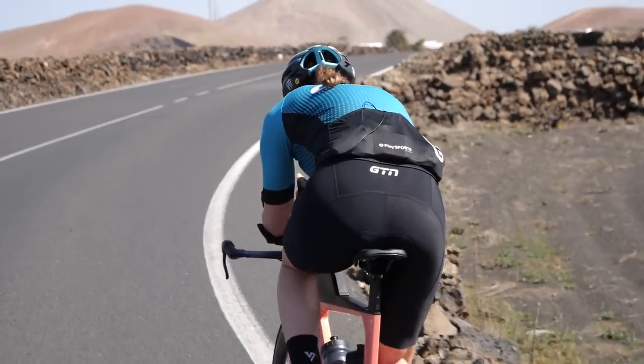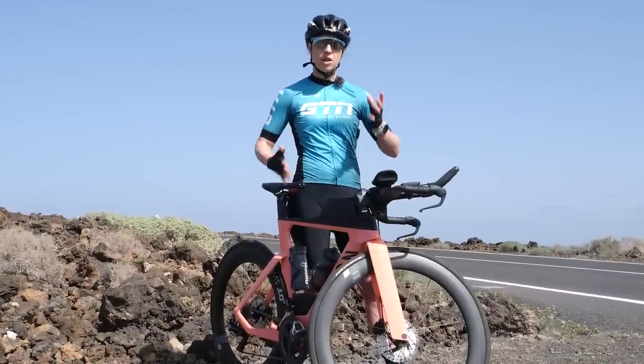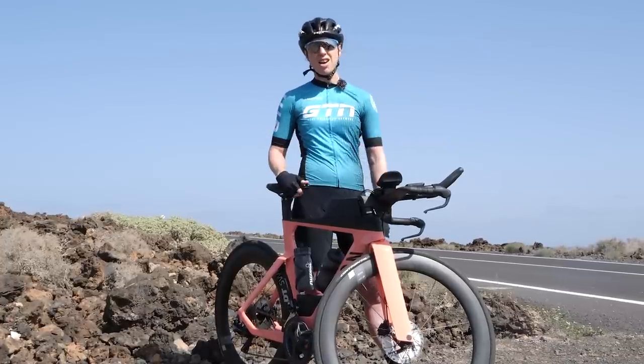It's far more accurate to actually get on your bike and ride. The clue is in your hips. You want your hips to be remaining pretty still when you're on the bike. If they're excessively moving side to side, that's usually a sign that your saddle is too high, or if your knees are coming up into your chest, that's a sign your saddle's too low.